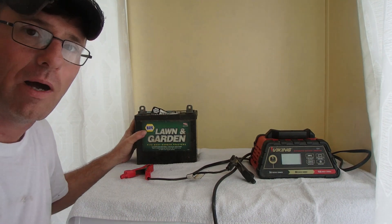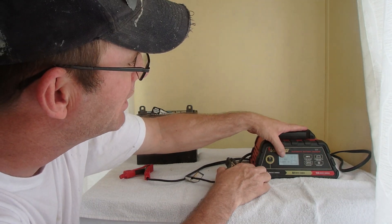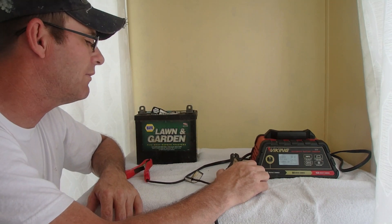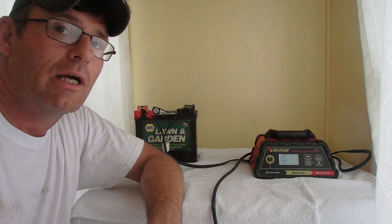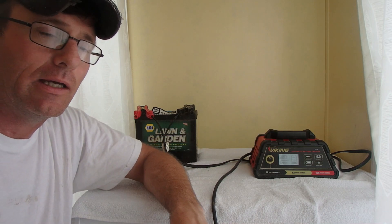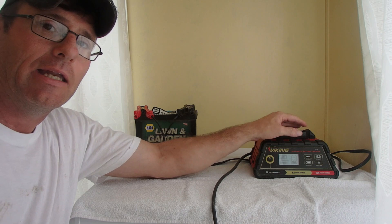One other thing I've noticed — I have a battery right here, we're not sponsored by anyone — but when you first turn it on it says 'Please put the clamps on' and it shows a picture of the battery. What I've noticed is if the battery is less than 10% charged, it will not charge that battery. It will not start charging, it will not do anything — it will deny the battery. I feel like that's a bad issue with this charger.